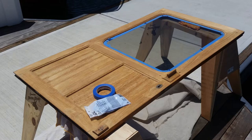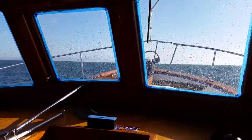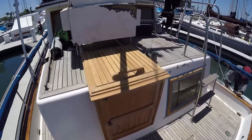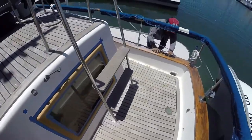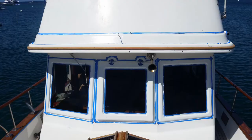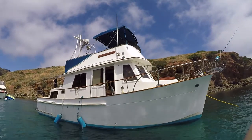We stripped the side door and followed the same process for that item. For the windows, same epoxy treatment. We took a break from the work and took the boat out to the island for the weekend. With white primer applied the following week, they resumed stripping down and removing all the caulking from the aft hatch and door, more sanding progress on the cap rail varnish. Here is what the windows and eyebrow look like with two coats of white primer applied.